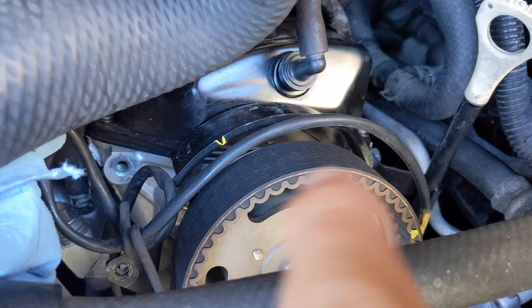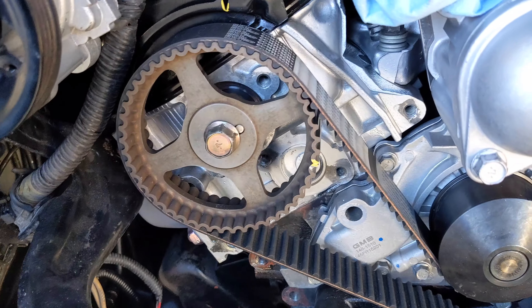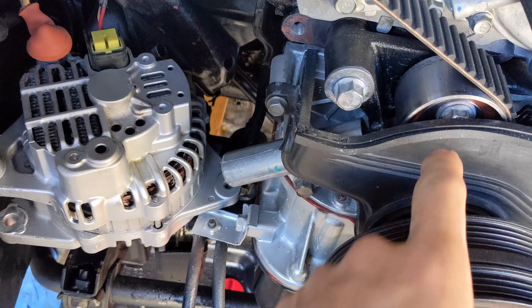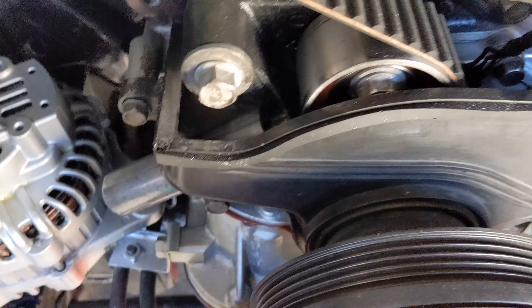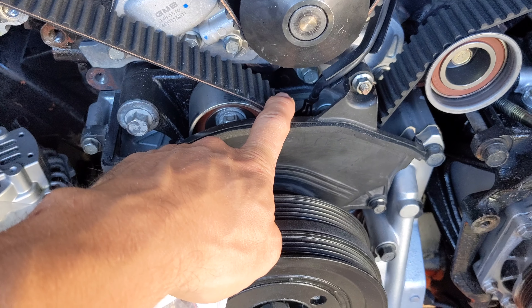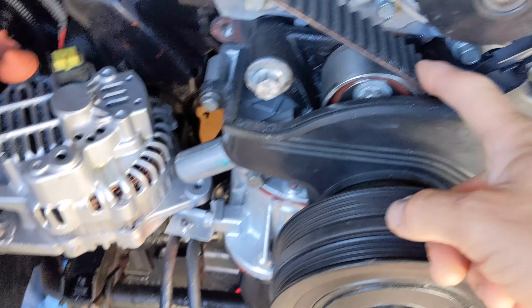You can see this one is super deep in - that's bad. This one is not leaking but it has the sensor wheel so you can't see it easily. I'm going to proceed with putting it to top dead center, align the marks, zip tie the chain, and that was my idea - pull the tensioner in until I can put the pin back in the pin hole. But I may have to remove the crankshaft pulley. I need to hold the tensioner so it doesn't open all the way.